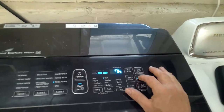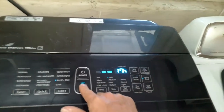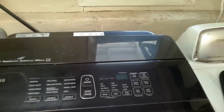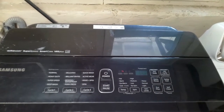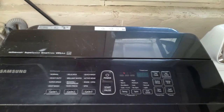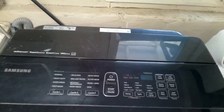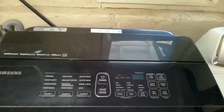Go to 17 hours on the delay, press and hold the start button until AS appears, then press start once more and the machine will automatically go through all the cycles. CO means cold water — if you activate that code and you're not getting water into the tub, check the inlet valve or check for clogs. The next one is HO which stands for hot water — same thing, if you're not getting hot water into the tub, check the valve or check for some type of material blockage.